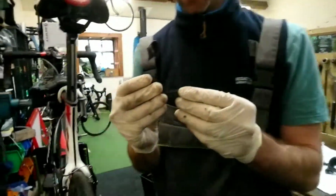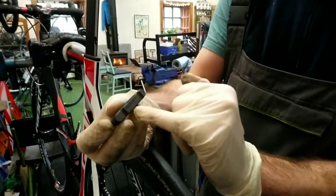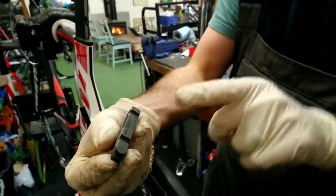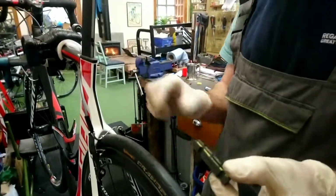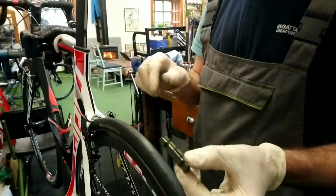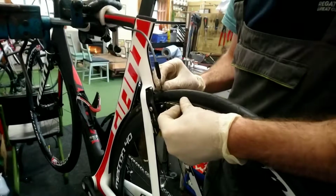Right, and then when you're putting it back on, usually if you look on the back of the pad as well, you probably won't be able to see in the video, but it does say left. Sometimes they'll have an arrow pointing forward as well. So in terms of forward, usually the direction that the wheel rotates when you're moving forward. So put it this way, and you just slide it back in.